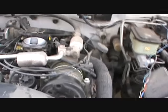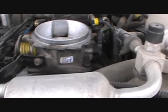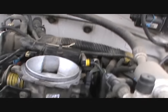Hey, got the right one the first time. So, alrighty. Oh, I was going to add to this before. The complaint with my truck here is I've noticed once in a while I have to let up on the foot feed to get it to shift. And there's been a couple of times when it shifted, it just went boom! The only thing that came up was the throttle position sensor, and I guess that also helps control the shift points in the transmission, which makes sense now.